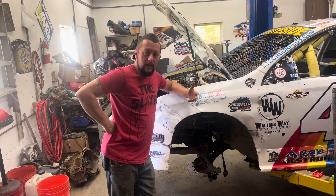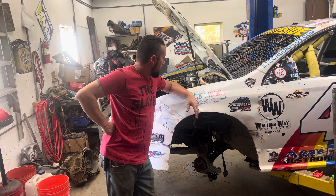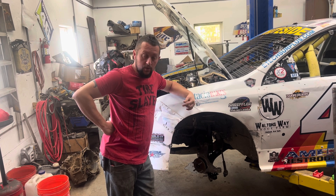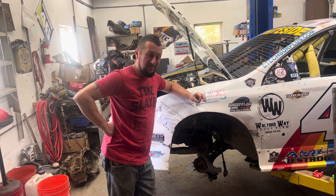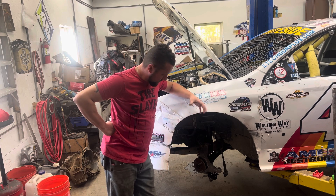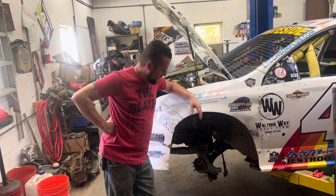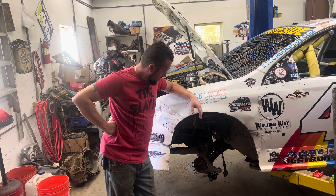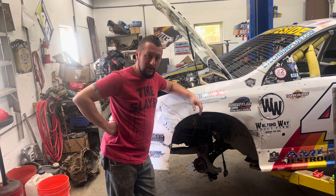What's up, y'all. Yesterday we got the motor in and got it fired up. We found a bad timing chain tensioner — had to take the valve cover off and swap that out, and that was brand new, so we ended up taking the one out of the old motor and throwing it in the new motor. Now it runs good. We ran it up to temperature, revved it up a few times, everything appears to be good. Right now I just hung that new strut in there — I gotta tighten that up. We gotta put all the drivetrain back together — axles, brakes, all that good stuff — and hook the steering back up. Get her back down on all fours.